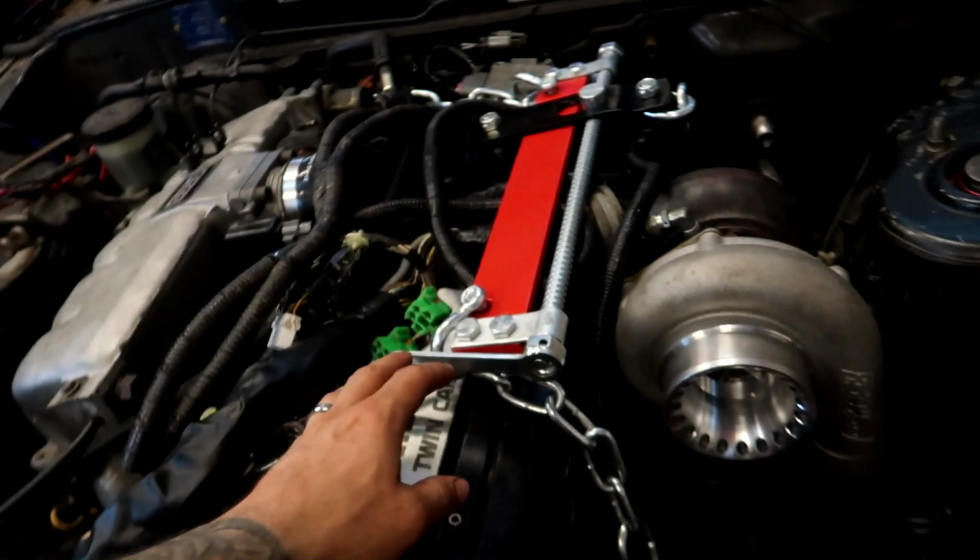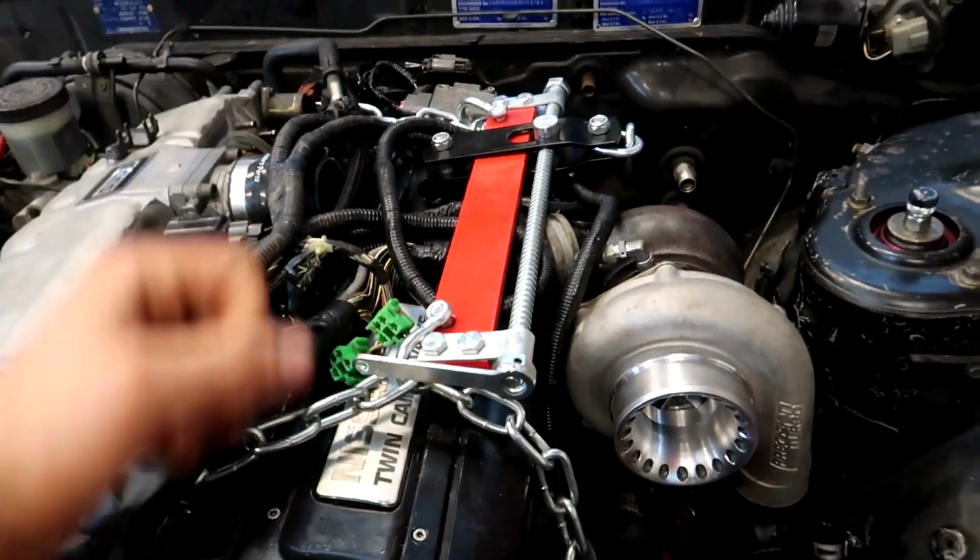When you're putting an engine into a car, with two people it's a lot easier. One person sucks. Two people, you can have one on each side and you can just jimmy it in. It's not that bad, especially with the right equipment. Dad used to use seat belts instead of the leveler, just a couple of seat belts hanging off it, and they're super strong, but the leveler does make it easier. If you do the seat belts the right way though, it is pretty much the same. So you don't need the leveler, it just makes it that much easier.